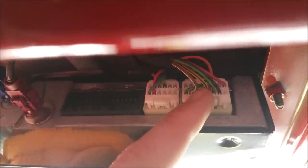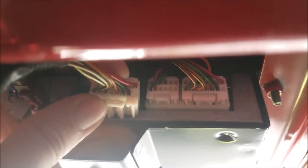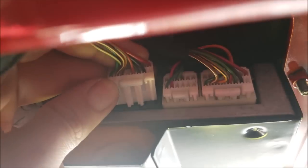Regardless of whether you have Bluetooth or not, we only need to utilize J3. I don't have a factory plug, so I went to the junkyard and pulled this plug from a wrecked car, snipped it. Unfortunately it doesn't plug right in, so we're going to take the dremel, drill these keyways down a little bit, modify it to fit, and then remove the unused wires because we're going from all of these wires down to just two.